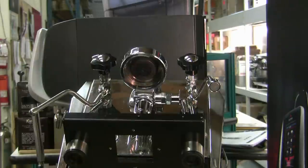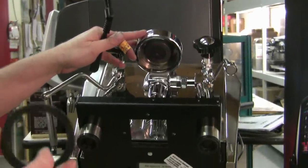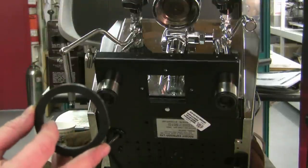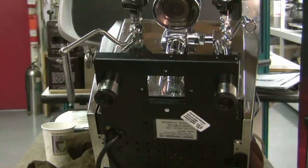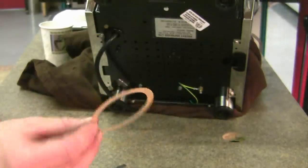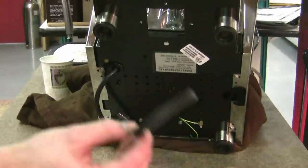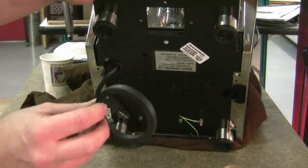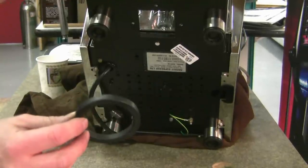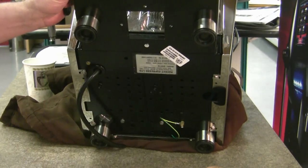New screen. It is a slightly larger than 8mm gasket — this is the Rocket gasket. When you buy it off our site, we always give you a 0.5mm group spacer just in case to provide a perfect fit. But as an alternative, if your group head is a little more worn or deeper depending on your machine — the E61 group head varies across different machines — you can get the standard 8.5mm gasket.